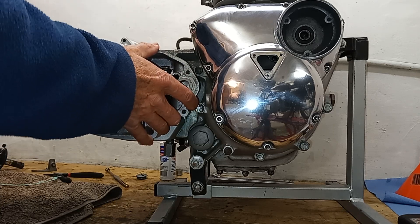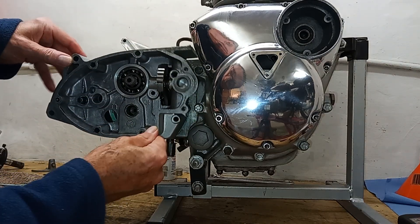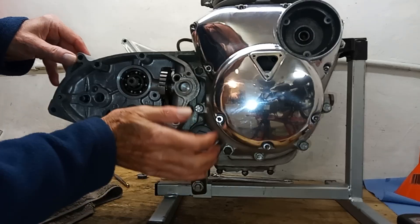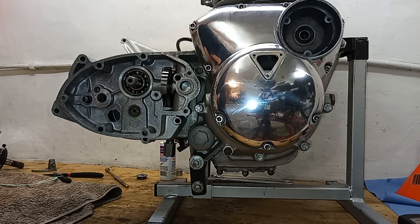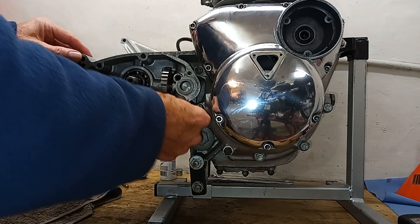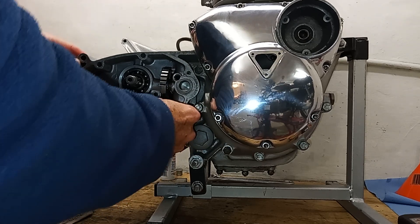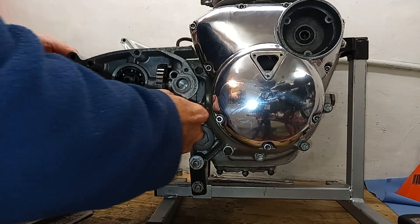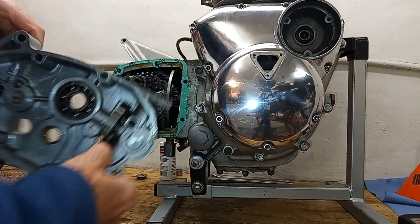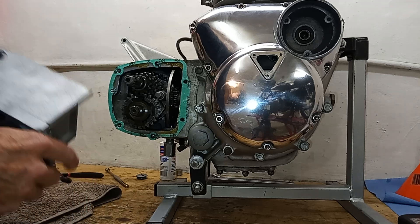The main shaft is going in, and looking down I can see the layshaft going in, and I can feel that the selector fork shaft has gone in. Now if I push this fully home - let me come back out and double check before I start forcing things. That should be in the right position - yeah.